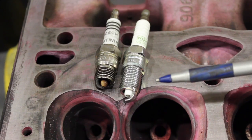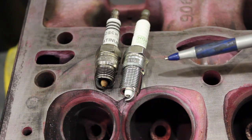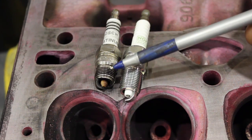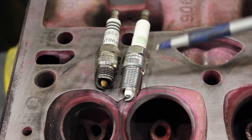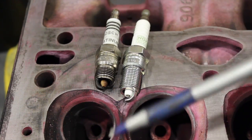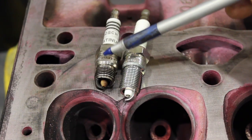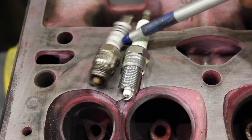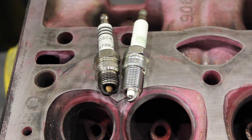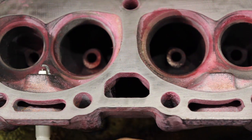This is a TR55GP plug by NGK - this is your typical stock heat range. We'll get into that later, but this is your stock plug out of something like a C1500 pickup that came with Vortec heads. Beside it we have a traditional small block plug for something like a 1980 Camaro with 880 or 882 heads. The threads are the same - this old-school plug will thread into a Vortec head - but as you can see the reach is quite different, and I'm going to show you what that looks like screwed into the head.